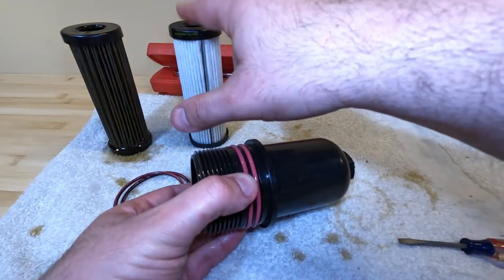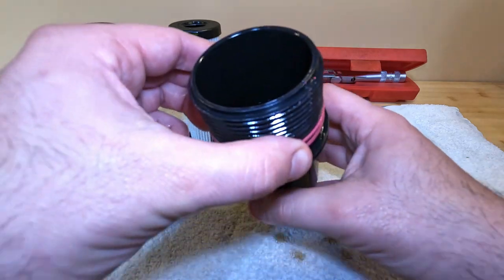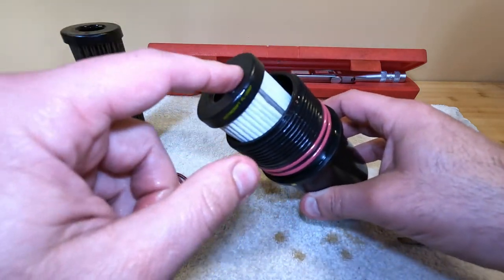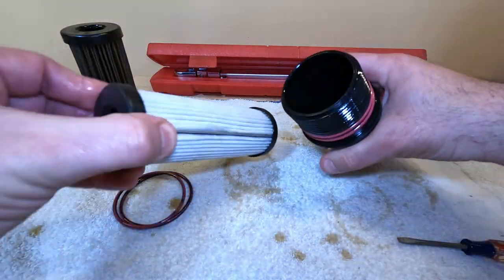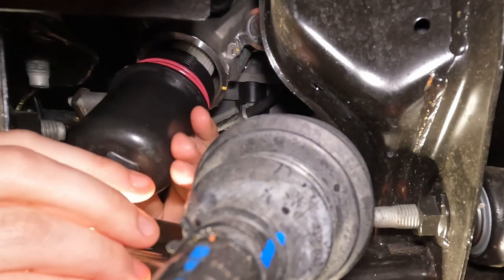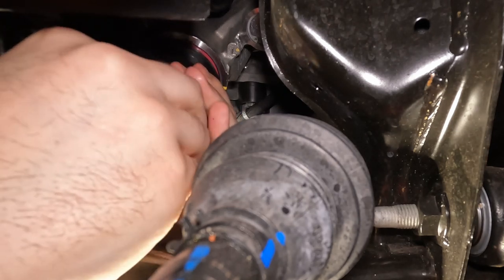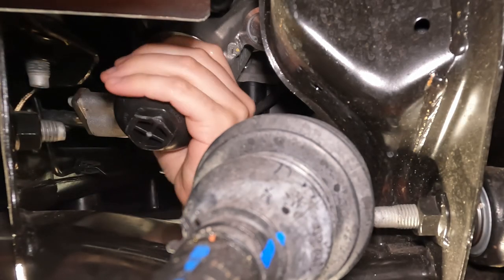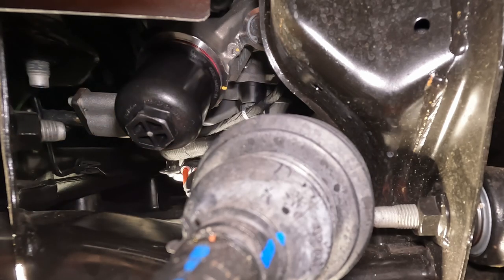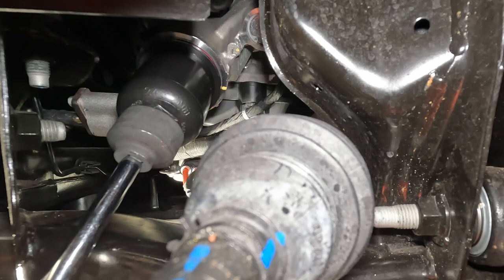If you order this as a kit, it comes with one of these 2087 filters if you're having a hard time locating it. Wipe things down, make sure everything is lubricated, and the filter will slip into the housing. I'm actually going to mount the housing on the car first, then thread the filter into it. With the oil filter mounted into the adapter on the engine, I'll slide this on very carefully, just rotating it until the threads start to catch. You could try to line up the original factory marks — I don't know exactly where you'd need to start the threads to line them up, but worst case you can always put your own marks on as a reference. It should have very little resistance going in.